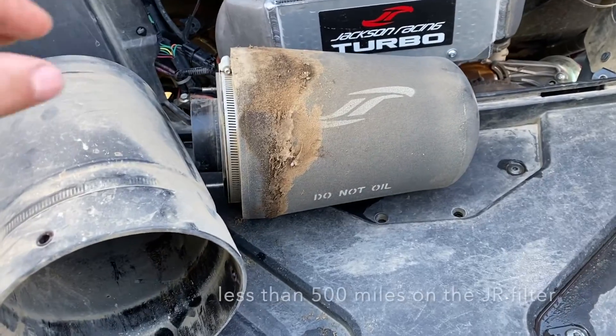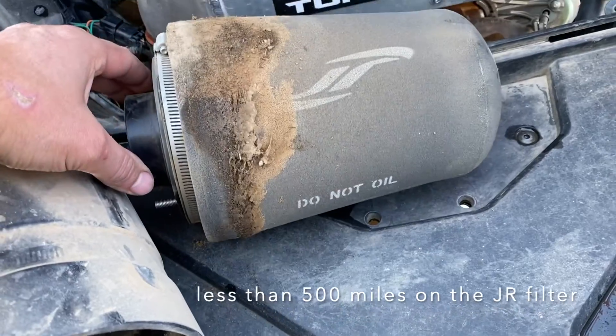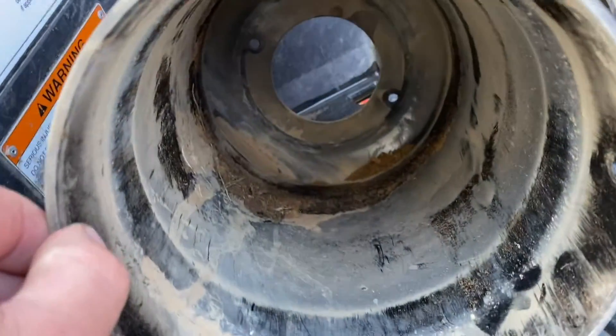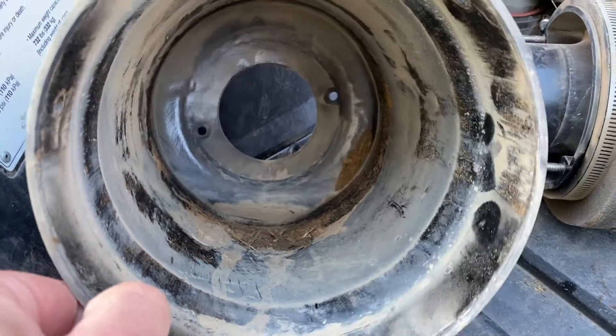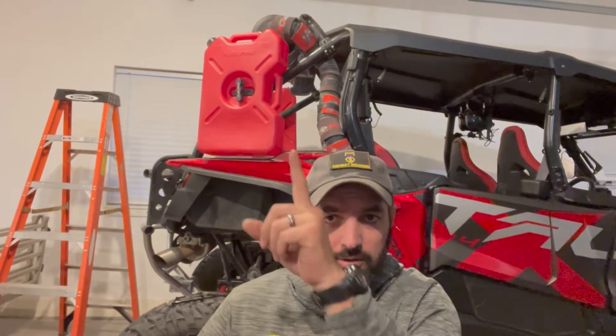Over the last year I've been adjusting: pulling the filter out, doing some duct work, and adding the particle separator to the turbo kit, which has been great. Instead of 300 miles out of a completely plugged-up filter — and not only was it plugging up, but it was getting mud inside the canister because the moisture couldn't drain out — it was a huge mess. I was able to relocate the filter housing up higher and hook the particle separator, which was great.